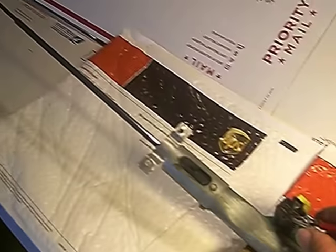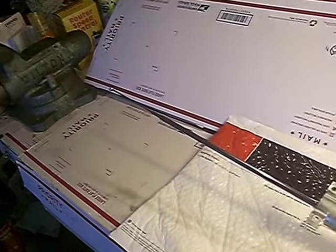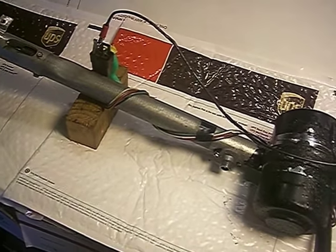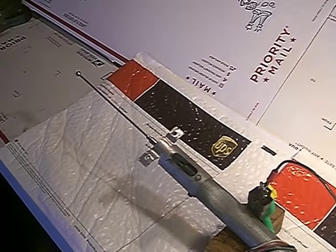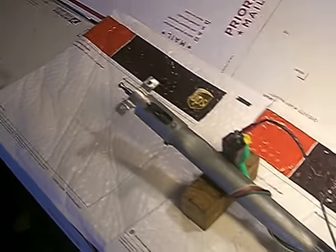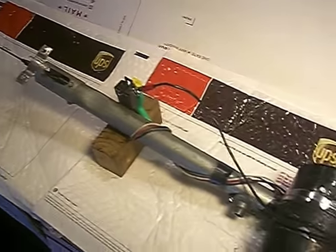And we'll go ahead now and do a full retraction. And when the unit's fully retracted, it'll self-park the motor. And there it is, shutting off. So once more, green wire gives us the 6 to 8 inch actuation, and it limits and stops the antenna. We'll do another full retraction as if we were shutting off the radio, and now we'll do a full extension as if we were using the up button,